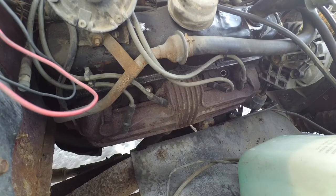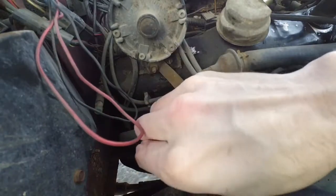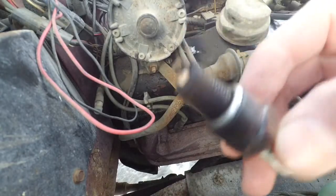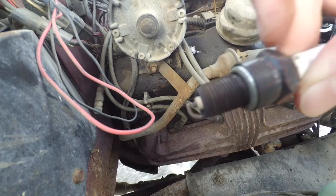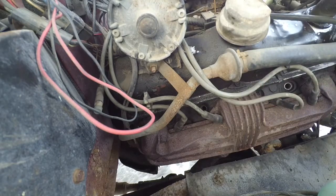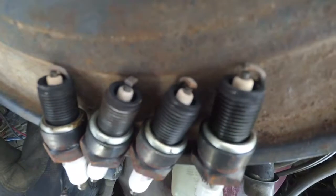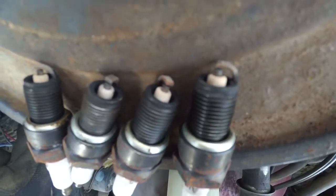That's telling me so far we're not looking at a lot of difference between each cylinder. Taking out number six. Again, pretty consistent with what they've all been looking like so far — not too bad. Let's take a look at all four here on the passenger side together. Pretty consistent, they're all pretty clean. There's not a lot of black gunk, which would indicate either blow-by or burning oil in a cylinder. So they all look pretty good. Let's go see what the other side looks like.